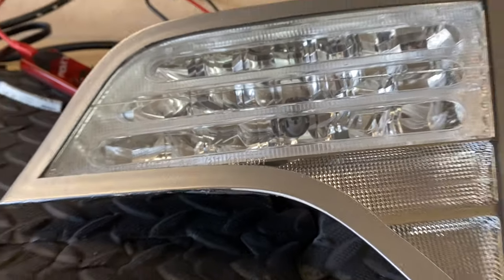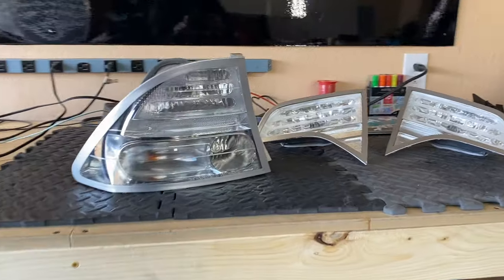The only other step is to replace the halogen bulbs with red LED bulbs. I do recommend leaving the turn signal bulb as the amber halogen, because the LED one is going to make it hyperflash. If you don't mind the hyperflash you can leave it, or if you really need the LED turn signal without hyperflash, you can use load resistors. I personally don't like using load resistors and don't want to tap into the OEM wire harness, so I always just leave the regular halogen orange bulb in there. After the bulb replacements, they'll be ready to ship.